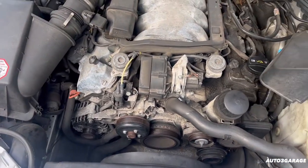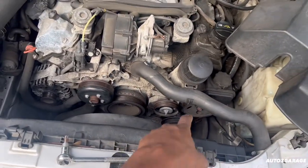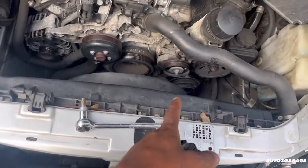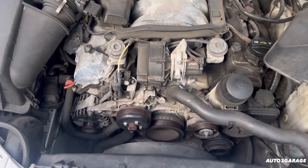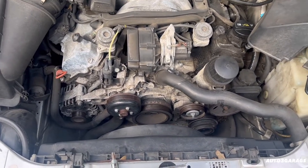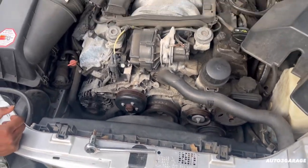It was really hard to turn the car, being that the belt was off. Everything — your power steering pump, water pump, alternator, tensioner, AC, and your cam — so it had a really heavy turn and stuff. Pretty crazy.